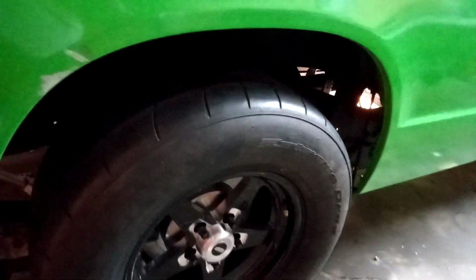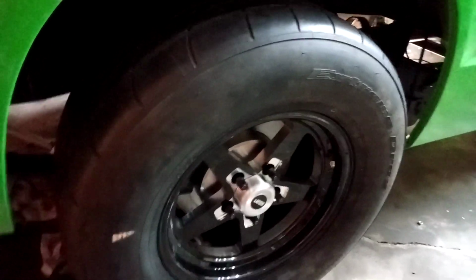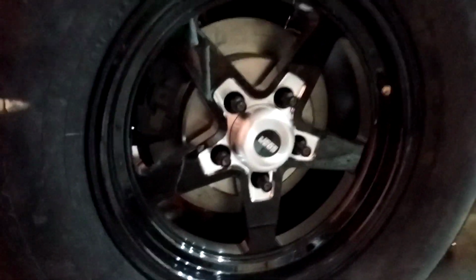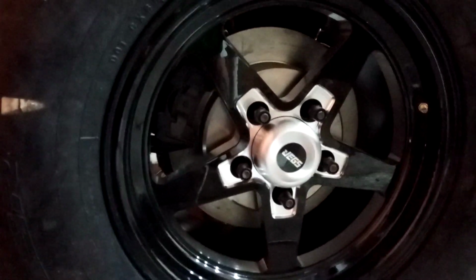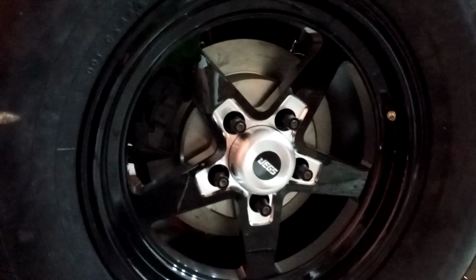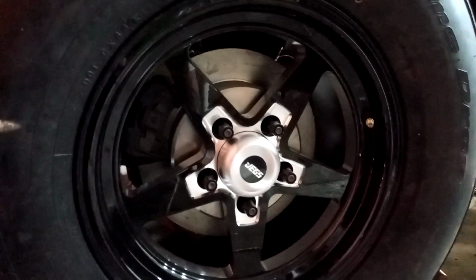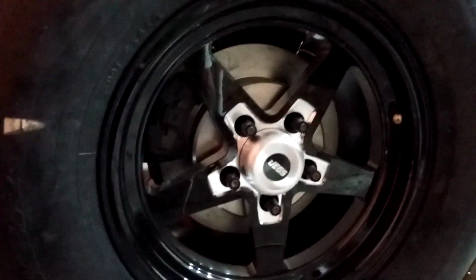But I really like these wheels. They're those Jegs. I think they're actually made by, I can't think of the wheel company, Ultimate or whoever makes them, but these are a 15x8 with a 5.5 backspace. And on an S10 I would normally run a 15x8 with a 4.5 backspace, but I added an inch because of the 8.8 even being narrowed is still 3/4 of an inch wider.